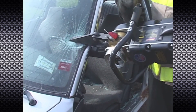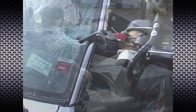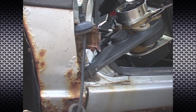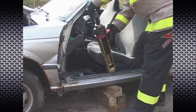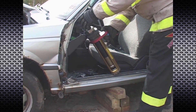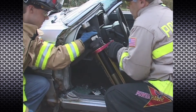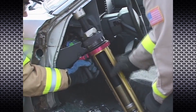Use proper extrication techniques to prepare the vehicle for the dashboard roll. This may include flapping or removing the vehicle roof and making the necessary relief cuts into the frame or body. Determine the engagement points of the Power Pusher, noting that a 45-degree angle will provide the greatest leverage. Crib directly underneath the rocker panel at the point of the Power Pusher's engagement. With the Zipnut in the lock position, hold the Power Pusher into position so that the slot faces outward and can be easily accessed by the spreader tool.